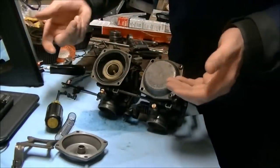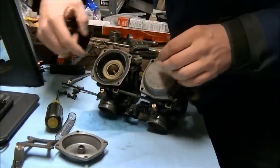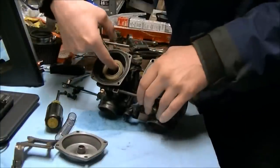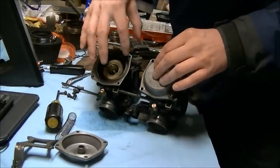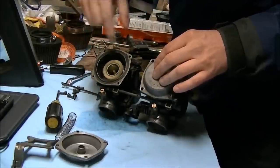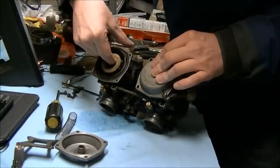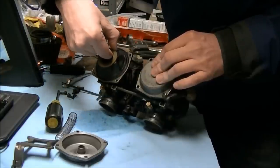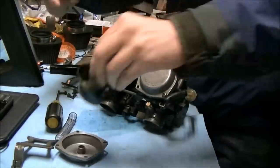You've got your diaphragms. The best way to get the diaphragms out — pull it up from the center here. Don't grab at the rubber part. Stick your finger inside here and just pull out. Note the notch here when you put these back at the end. They are directional and this little notch has a little groove that the rubber part has to sit in. These just pull out — be nice and careful. It's okay to leave them inverted like that.